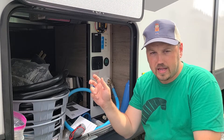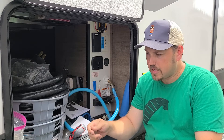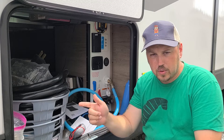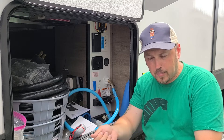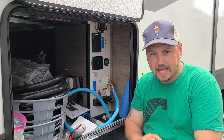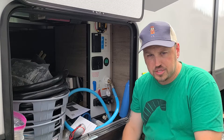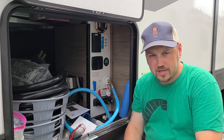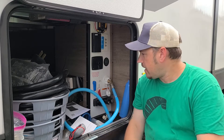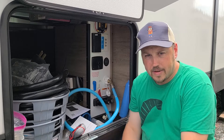To shut those remaining items off, most people install a 12-volt switch — like a marine boat switch — on their battery box. That goes in between the lines and permanently disconnects one side of the battery so you're not feeding anything. That can be great for when you're in storage or ready for winter in a climate where you don't have to pull your batteries.